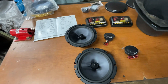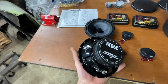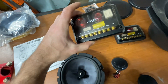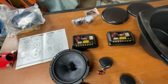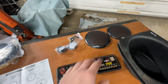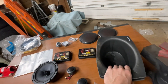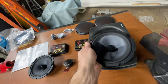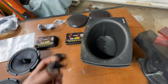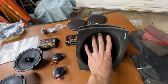For the door speaker setup, these are the Skar Audio TX65Cs — these are hefty, they've got some girth to them for sure. They also come with tweeters and crossover boxes for distributing the signal. You put your wires in, the wires come out, and it goes to each speaker. Comes with speaker grills and mounting hardware. I also have some Boom Mat baffles — these are six-by-nine — because the way I plan to mount them, one low, it'll give me enough space up top to mount the tweeter and keep everything out of the elements inside the door.